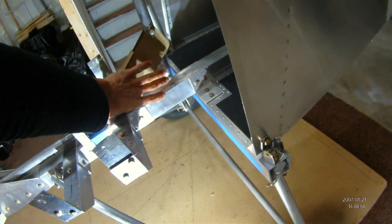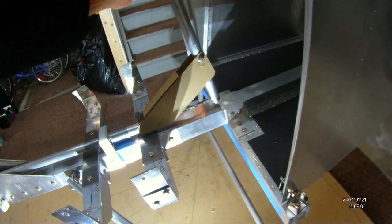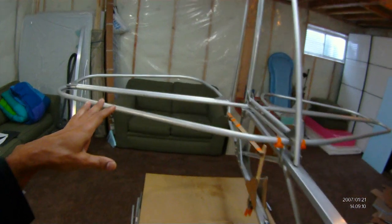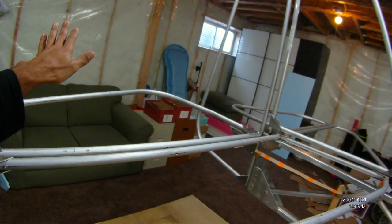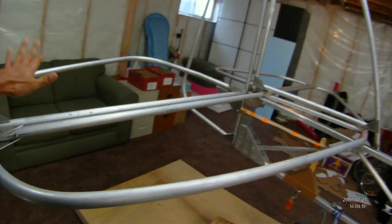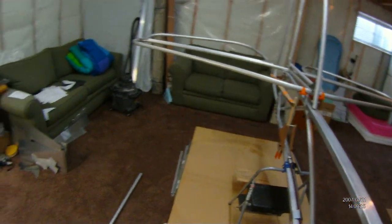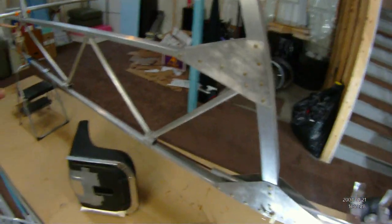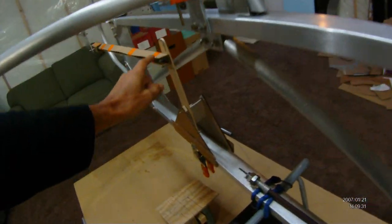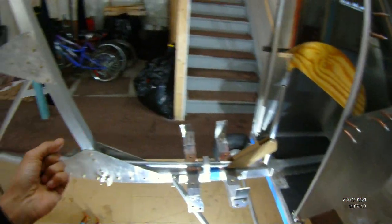This is a critical piece — this angle had to be about seven inches by five inches to give me enough throw to get good up-and-down elevator movement. With this bell crank system I'm going to get about 40 degrees up and about 25 to 30 degrees down, which is plenty of throw — the ultralights I've flown, that's a ton. Coming into land is when you use most of your elevator to flare, but I think that's plenty. I've also put a hole here and a hole there so I can adjust how much throw the controls have, depending on how I want the plane to feel and fly.